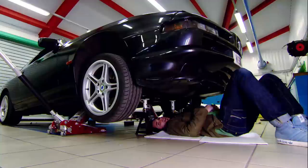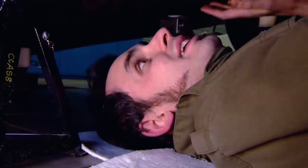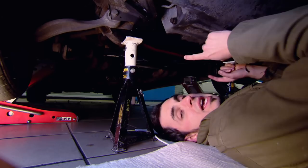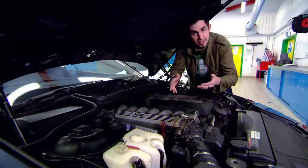One area to check thoroughly is the suspension, because there's an awful lot of ball joints and bushes on this complex setup. Because the car's quite heavy and they're getting on a bit in terms of age, they tend to wear these bits out. Get it on a ramp ideally and have a visual check, or take it out on the road, get it up to motorway speeds and check to see if the car's meandering or shuddering around. If you need to replace all four suspension joints, it can cost you 1,500 quid. Next, start the engine — the V12 is known for being a dependable tank of a motor, but listen to it running for any loud cam noises, because the oil rail that lubricates the camshaft is known to have bolts that work loose. If they do, it starves the cam of oil, and if that happens you'll expect a two grand bill.